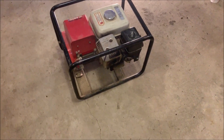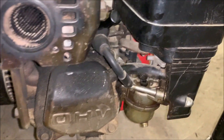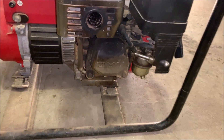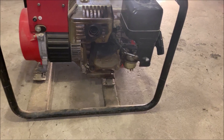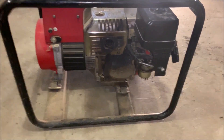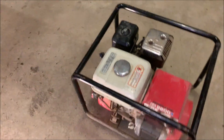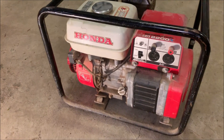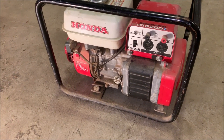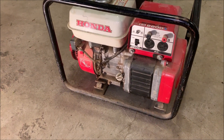The power output I haven't measured yet, so we'll take a look at that together. The only other thing that seemed a little odd was there's a lot of exhaust staining on the top of the valve cover, so potentially there's an issue with the muffler — I might dig into that a bit. But overall this thing's in pretty good shape. Let's bring it outside, start it up, do a few tests, and go from there.